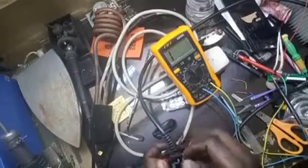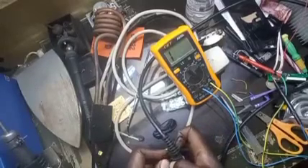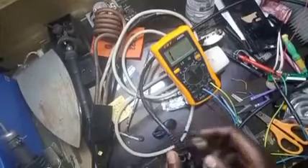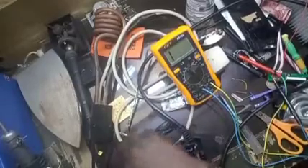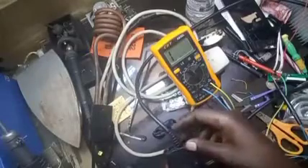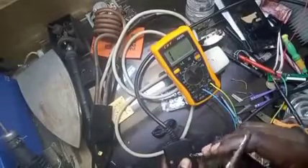If I do not cut the wire, after 2 or 3 weeks they will bring it back with the same problem — the fuse and plug burned again. And next time it may not be only the plug and wire, because the resistance created by the coil is very high, so it does not need a long wire — it just needs a short wire. Every coil needs a short wire. If you need a longer reach, you should extend using a proper extension.